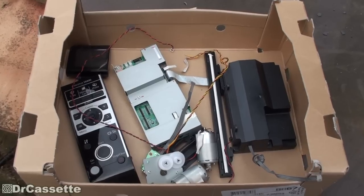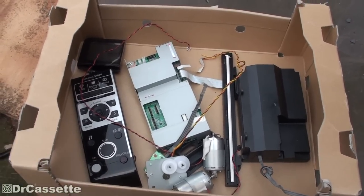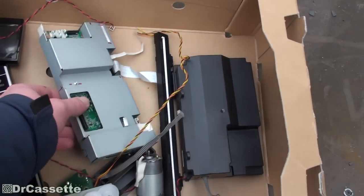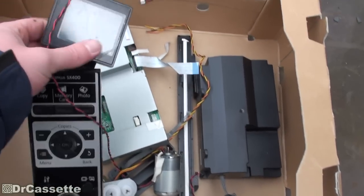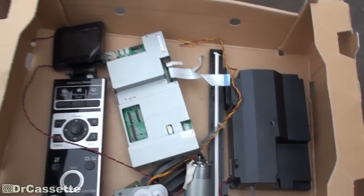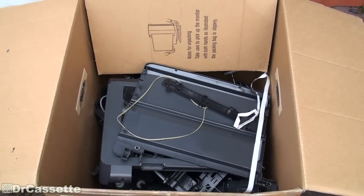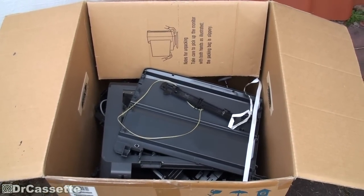There we have all the useful parts in one spot. We've got two pretty strong motors, a lot of screws, the control panel electronics, a USB jack, and the power supply — which most likely has outputs for 5 volts and 12 volts, so that can be used for something the way it is. There's a handy little jack on there too. I'm going to look up datasheets and take these modules apart to see if I can come up with something useful. I am particularly interested in that little display and what makes it work — maybe I can actually get that thing to display something. Anyway, there we have a big box with a load of junk going to the dump. An Epson all-in-one printer teardown — thanks for watching and see you again soon.